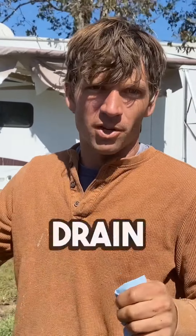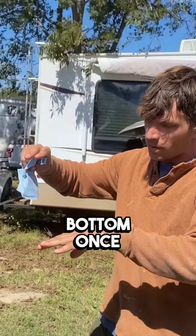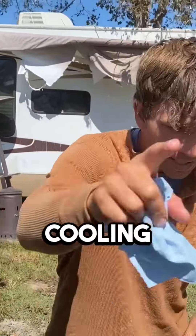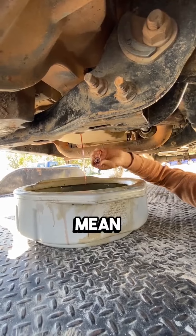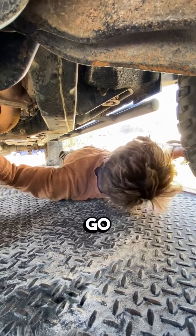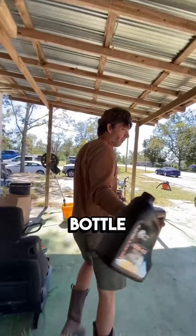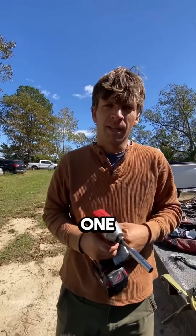Last one is the transmission — that one's the tough one. We're basically gonna have to take the transmission pan off and drain it. That's the main one you want to drain on a flood vehicle, because right now it's all separate — transmission fluid, water on bottom. Once you crank it up, it all mixes together and goes through the whole system, and pretty much the only option at that point is to change the transmission. That fluid looks great, really good. We'll catch it in an old 15W-40 oil bottle and let it drain. And if anyone likes dad jokes — this is a really draining business.